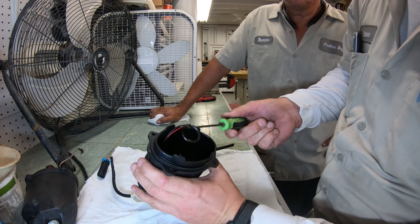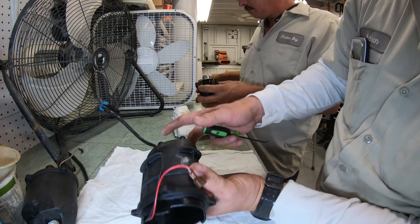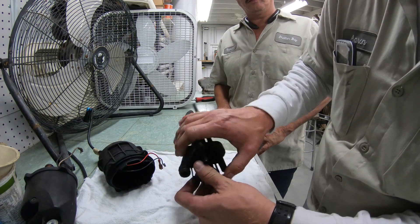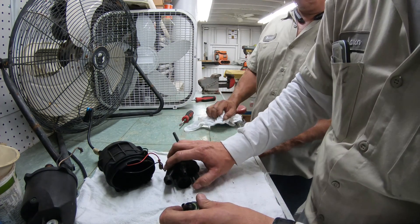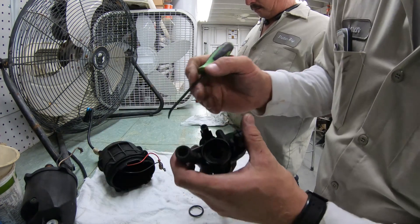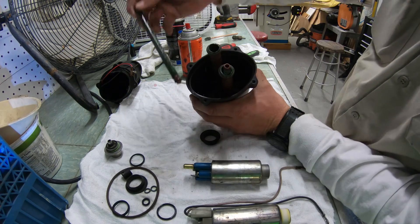Then fish out all of the o-rings and rubber gaskets that go on the pumps and the four copper tubes that run the fuel and water. On the top of the top piece that we pulled out there's a fuel pressure regulator. You're going to want to pull that out by bending the two tabs over and pulling it out — this will most likely need to be cleaned. Continue pulling out all of the rubber pieces from the top piece, then you can pull out the fuel pumps and the copper tubes that are probably still stuck in the bottom housing.